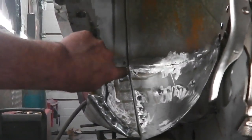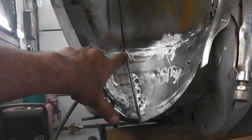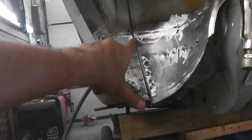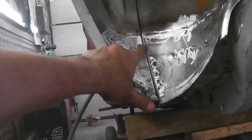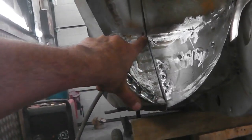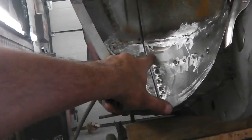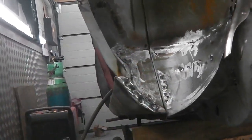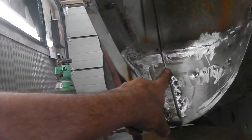There is a little train spotter issue, I suppose. That line there tends to go too straight. I think this would have had a slight curve just on that approach before it finally hits the sill. So this bit would have had a slight curve in it. Now I could risk bashing it and put a little bevel in it. It's just missing a scallop. As this comes down on the radius, then it goes straight. It's just that bit there just annoys me a little bit. You could strike that, you could heat it with a gas and strike it, but a risk damaging it.